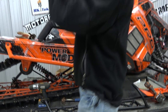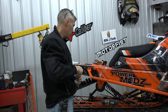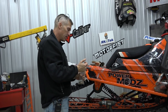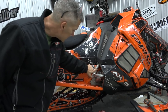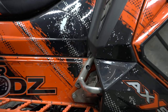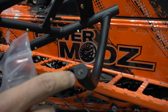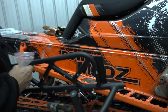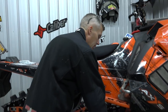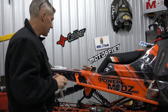Now we are going to drop the suspension because we need to get in. First I'll drill out all these rivets, but then I need to drop the suspension so I can get in at this little bolt here. As you can see, this hoop is threaded, so you have to thread the bolt in from the back side of that. That is the trickiest part to get to, but we can do that — it's not going to be that difficult.